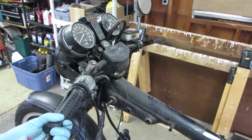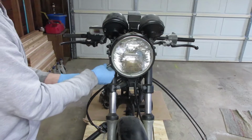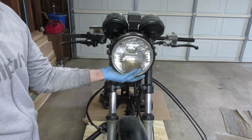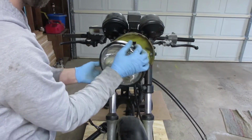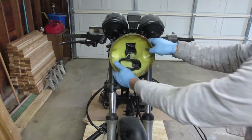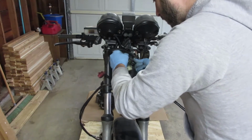I have a feeling that when I start to rebuild the bike, I'm going to be needing to do quite a few modifications to the harness itself. So what I did, prior to this project, was hide most of the additional harness behind the headlight. Luckily, removal is pretty easy. Now what I'd like to do is pull the entire harness apart, remove any superfluous wiring, and shorten it so that it's just the wiring that I need.